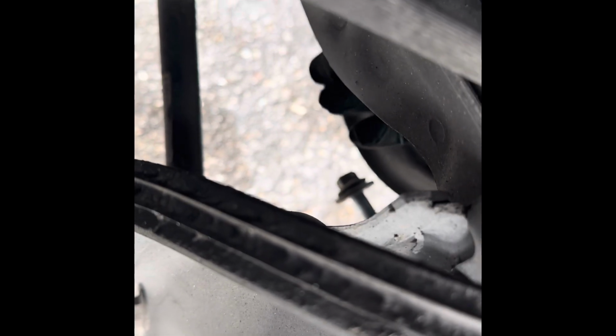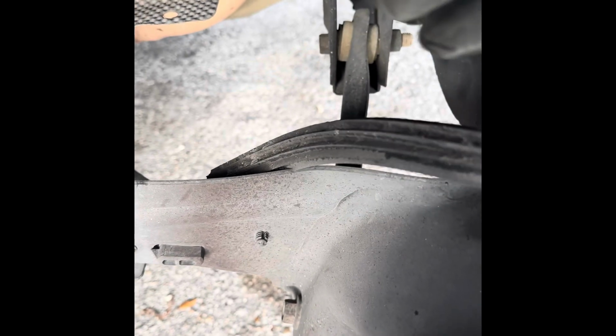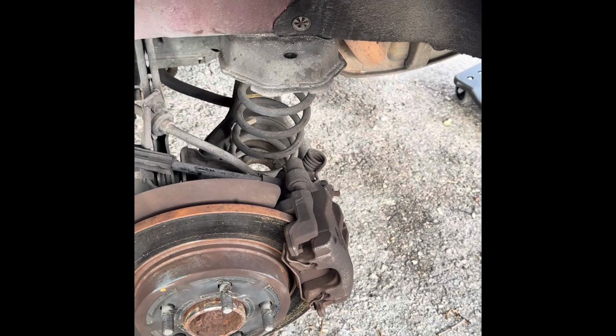And the 15, if I'm not wrong on this car, let me see. The 15 is this one right here that I left right here. So you have to remove the 15 from under the car. Release the top first and then release the bottom, and you're gonna be able to slide this thing out. I didn't have enough clearance because I don't have a lift and I'm not in the shop. So what I did is I went that way and stuck it out at this inclination.